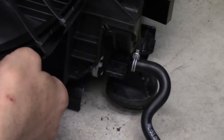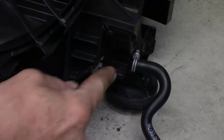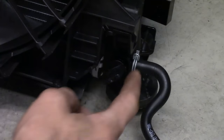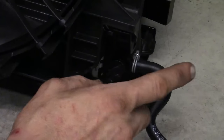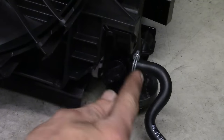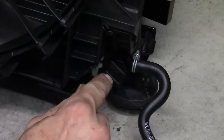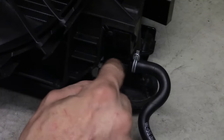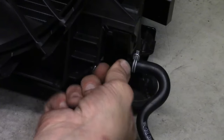While we still have this radiator assembly off the car, this is the drain. The drain is on the passenger side, bottom corner, inside the engine compartment. All you've got to do is grab it with a pair of pliers and start unscrewing it counter-clockwise — it's a ramp-type threaded system. Once it starts draining, it will come out this hose here. If the radiator hasn't had the drain backed off in a long time, spray it down with some lube, because there's an O-ring that keeps it sealed. If it's been on there a while, you could tear that O-ring and not know until you refill with antifreeze and find seepage around the drain or out the tube. So definitely add a little spray to help that O-ring as it's turning and coming out.